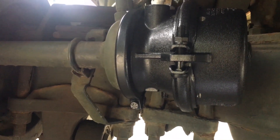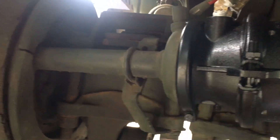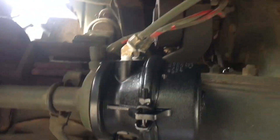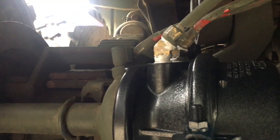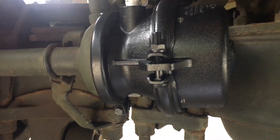It's pretty straightforward. If you buy the whole thing, it comes caged and clamped. You literally just take off the old military clamp, set the chamber up there, clamp it down, make sure you get the diaphragm seated properly with a brand new diaphragm, disconnect and reattach the airlines. I always use Permatex liquid thread sealant — not an endorsement, just a product I love. Put Permatex white thread sealant on both ends. Once everything is 100% secure, you uncage it — the caging bolt gets stored in the back side.